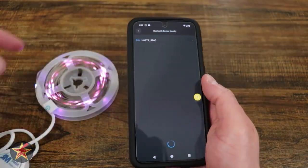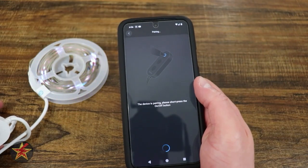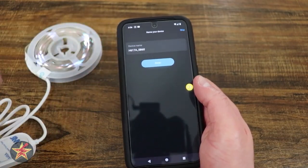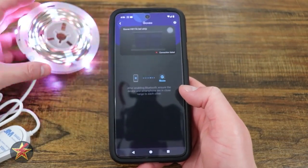It is very important that you look at the back of the box and notice that these are the H617A, so you can look and find it on the list. Because they have so many of these, I would recommend doing the search. Once you find it, select it, and you're going to allow Govee to determine your position. If you're using Android, allow precise location while using the app, and it's trying to locate the device. You can see it right up there — that's what we're looking for — and it's going to connect by having you short-press the on/off button. It found it. So we're just going to rename this so I know what it is, and select done. It connected.